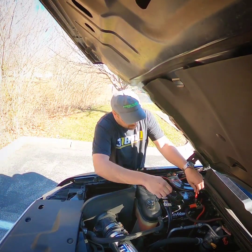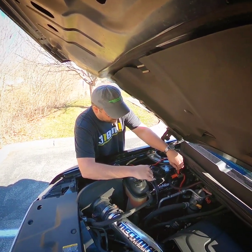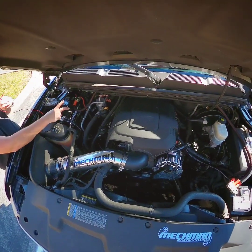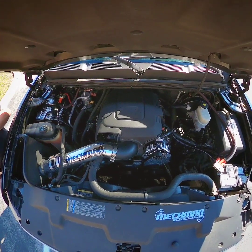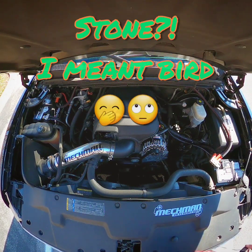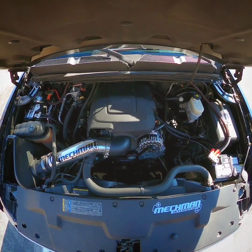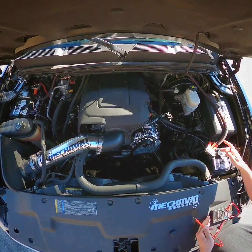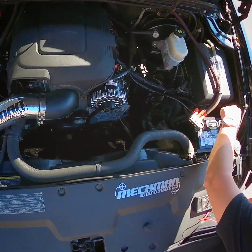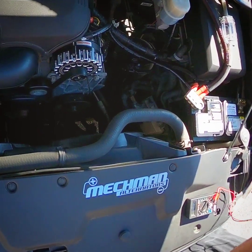Let's try the other one. All right, 12.7, 12.8. So it tells me both batteries are okay — both batteries are good. And it kind of kills another stone real quick there. It tells me that I have good connectivity or conductivity between each battery, so my wiring is good. There are no deficiencies or anything in there; the connections are solid, my grounds are solid.